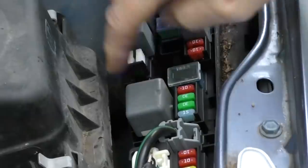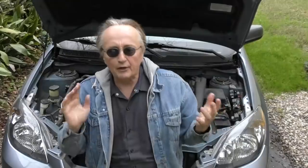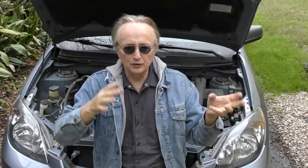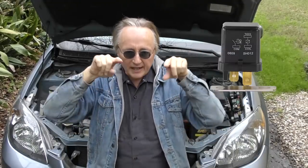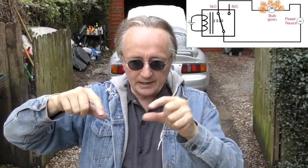The next electrical gremlins that can knock out your car are electrical relays. These are basically safety devices, and in modern cars they're all over the place because computers control a lot of electronics. A computer works on a 5-volt reference and only a few milliamps — not enough power to run an air conditioner or ignition system. So the computer sends a small voltage to a relay, and the relay — either electromagnetic or transistorized — takes that small signal and allows full battery power to flow to whatever device it controls.